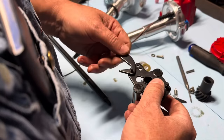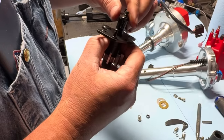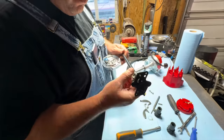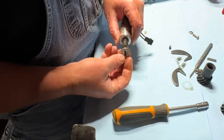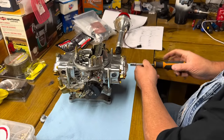While I've got it apart I'm going to go ahead and lock the ignition timing out. I remove the timing bushing, then turn the shaft 180 degrees and put the distributor back together. I did miss one crucial detail though — this is a slip collar distributor because the 572 in the Nova is a tall deck block. Unfortunately the slip collar was missing and I didn't realize it until it was time to put it in the car.